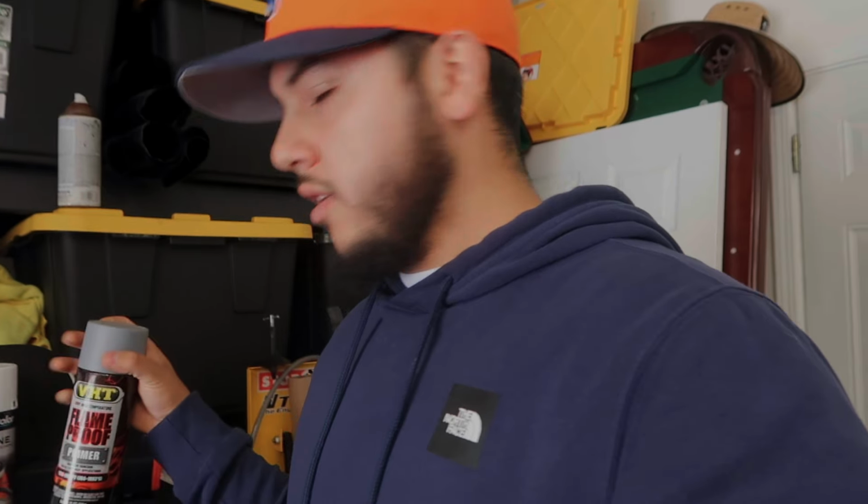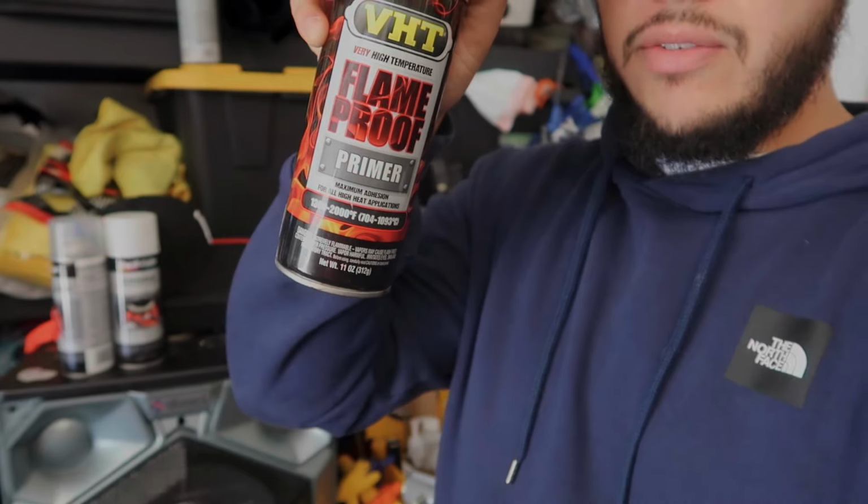So I don't know where I left off, but this is day two. Yesterday, pretty much, I just prepped everything, so today we're ready to start adding our primer. We're gonna be adding this guy right here, flame proof. So we're gonna do, I think, 2 or 3 coats. We're gonna wait 10 minutes in between, and we should be ready to apply our white and then our clear. So let's go ahead and add the primer.